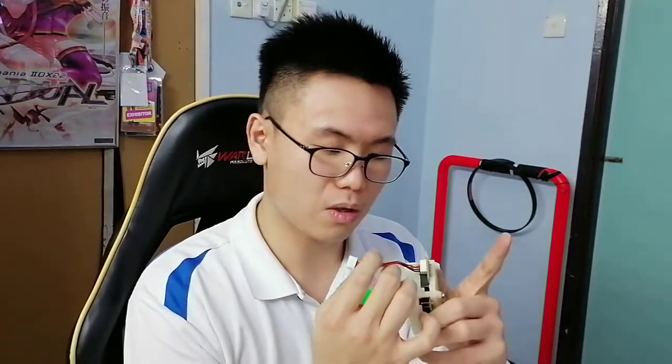This is one of the few fundamentals of how joysticks have been designed and made, so pretty cool. I'm definitely gonna ship this back to my customer, of course, but I do appreciate seeing how modular this is, because even though it's God knows how old, it arguably might still work. Probably not the best stick in the world, maybe unresponsive micro switches or something, but I think if I just desolder these switches out and put some new switches in, I bet these would still work fine.